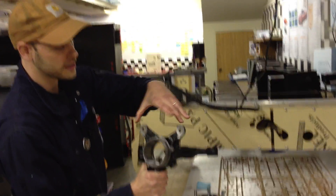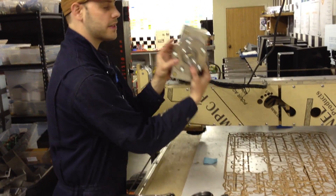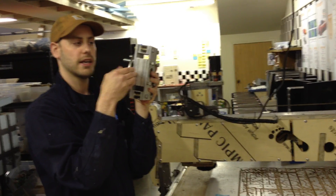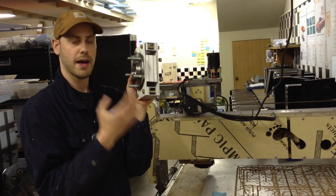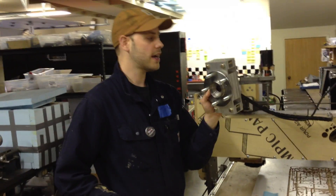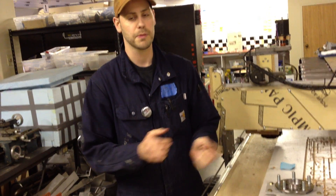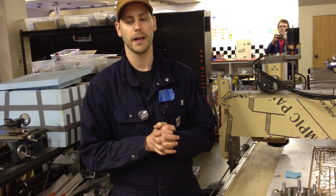Then these two holes — these Mickey Mouse ears — hold the caliper on, which brakes onto the rotor to stop the car. You'll notice the stock knuckle doesn't have those at all, but it has this stack of plates. One of these plates will have Mickey Mouse ears on it to hold that caliper on — the caliper mount. We can then adjust the height and shape of those mounts so that we can attach any type of caliper on to our car by having that modular caliper plate, whereas otherwise you'd have to cast a new part. So that's the modularity inside the stack of parts that can all be made on a home-built router that costs $2,700, or be made very easily because they're all 2D operations on a machine. If you are very precise, you can make them with a home milling machine or, if you're very careful, a benchtop drill press.